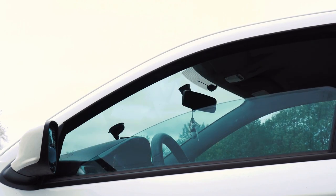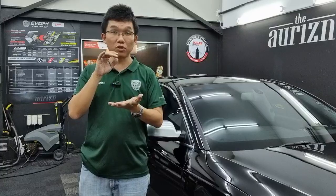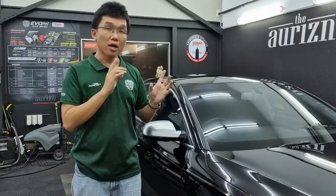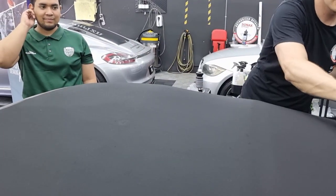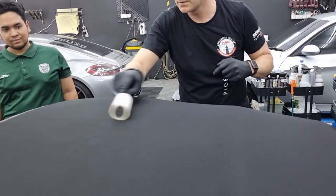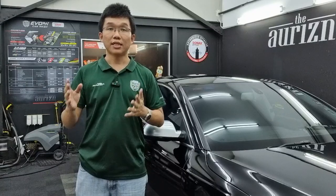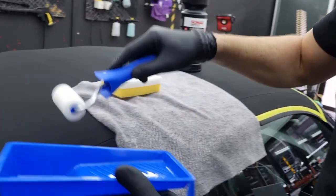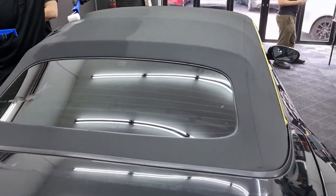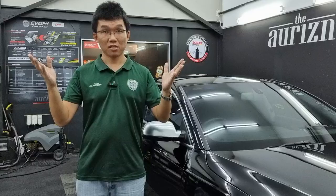It is even better if you can leave it overnight so the roof can dry thoroughly. Also, if possible, dry the car with the windows down, because some of the solvent used earlier to clean the roof — its vapor seeps through the fabric and may leave a bit of a smell inside the car. Once the car is completely dry, first check that the surface is as clean as possible. A lint roller may come in handy to pull out any dust that landed on the roof during the drying period. After that, apply the coating evenly across the entire surface using a compact foam roller, as recommended by Christian, for precise control over the spread of product.